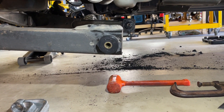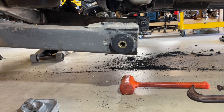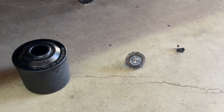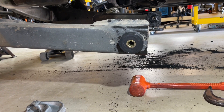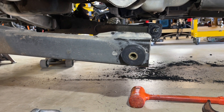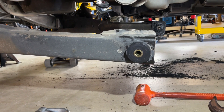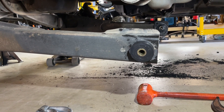Then I took a hole saw drill bit and used that to drill out the entire bushing — it came out in chunks, but it worked great. Then I used a wire wheel to clean out the hole. Then I lubed up the new bushings and pressed the backside in first — that was the one I was having issues with all day yesterday — went in with no problems. Then I pushed the outside one in, again no problems. Then I pushed the sleeve in using the ball joint press, and it's done and ready to go.